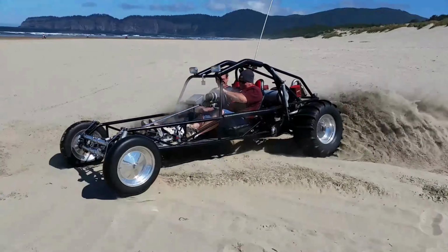So, wasn't quite sure what that was. Maybe it was a problem here, but now I think about it, I think it was just all the rust that was down in there. So this was a major vacuum leak in my engine. So this is probably number 4, I believe now, and boy, that engine should run a lot better than it ever did. So anyway, I'm going to test this and we'll see. And what it's doing is just actuating the diaphragm.